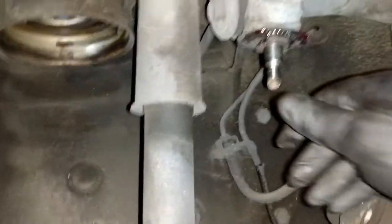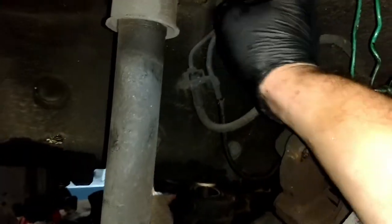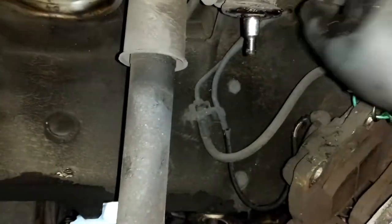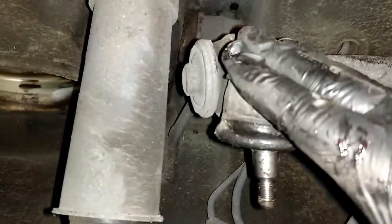I also popped loose the upper control arm, and these upper control arms — the boots are not broken, and they're still in excellent condition. I can't even move that one. Those are still in great condition, so I don't think it's necessary to change those. The bushings are in great condition too — they're not ripped, torn, cracked, nothing. That boot is still in outstanding condition, so I'm going to leave those alone.